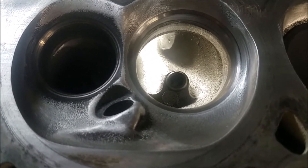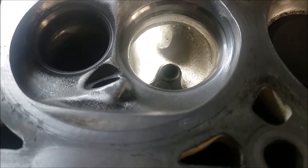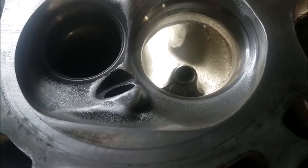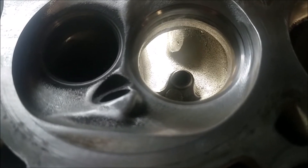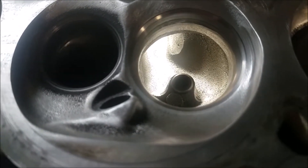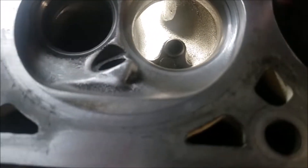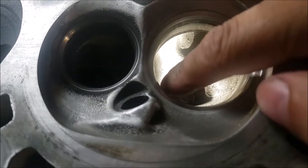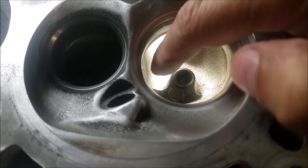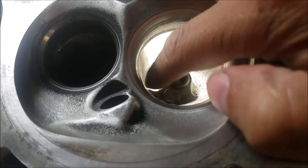One of the things you could do — let's say all you're going to do is just get rid of the rocker stud. It's over there in the back. You could do something like that to make it look better, and maybe also do something to the valve guide boss. You could leave the swirl ramp or you could get rid of it.